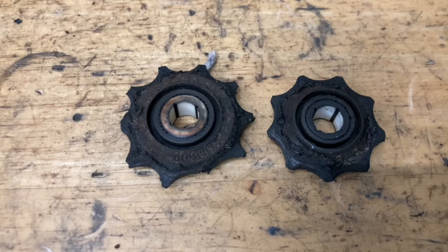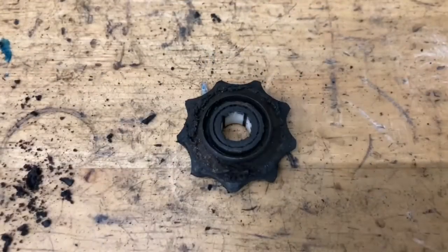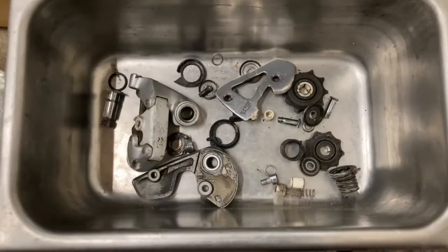I'll have a link for those in the description. I'm going to keep these on here just to show you how to do the ceramic stuff. For the 9-tooth pulley, the spacing might be a little bit off on the sealed bearing one I found, because that one comes off a chain guide, so you may need to put a couple spacers on each side. I'm using an ultrasonic cleaner with just water and dish soap.